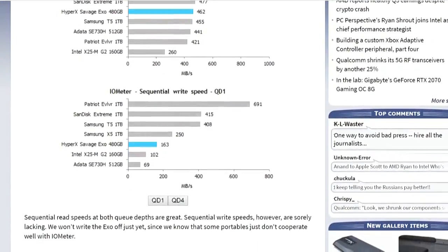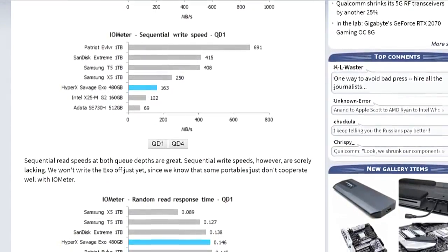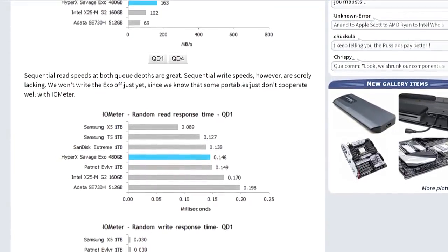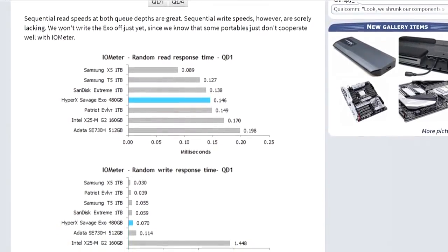Because 5 gigabit per second is around the throughput you would get for a serial ATA device, which is usually 6 gigabit per second. So it's around that 500 meg per second range. If you see something performing like that, chances are it's limited or held back by something. Maybe it's not negotiating at the faster speed, even though it's supposed to. Could be a cable issue. There are all sorts of reasons that cause that. It seemed to me that it should have gone faster than it appeared to in their review, but I don't have any other data points to rely on.